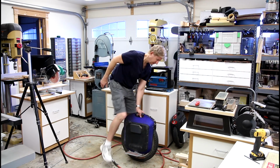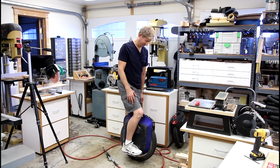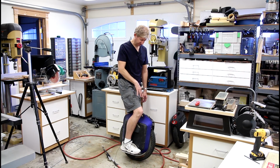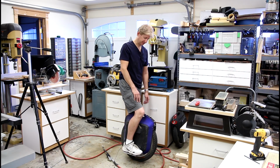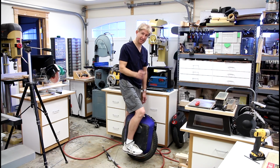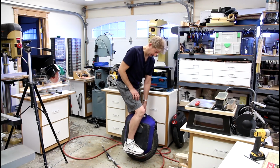So thank you again, Dan. I really appreciate this, and I'm going to extend the offer to anyone else who has a Monster and has loose axle nuts and wants to try and tackle this themselves. I'll send them the modified socket. Worked perfect, Dan. The slot had enough slop that I was able to turn the nut a quarter turn without the cable getting in the way.